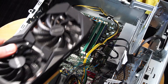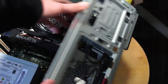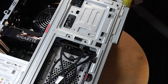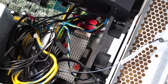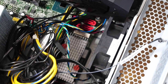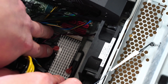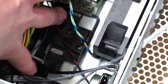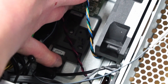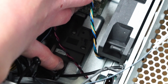Now the question we're all wondering — will the GPU fit? And heck yeah, it does! I should have installed the SSD before doing that, but in the spirit of making my life difficult, let's just do it with everything installed. These two little red tabs just have to be moved in either direction to release the heatsink. It's really dark and hard to see under all these cables, but there's a little plastic piece that'll fit in the end of the M.2 SSD — so no worries about a screw.